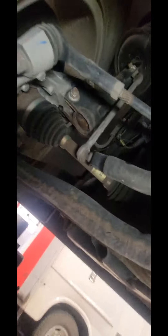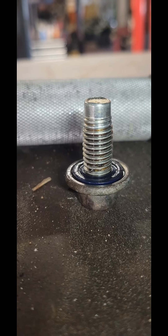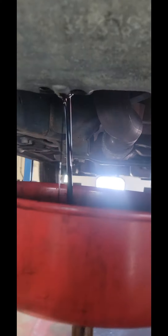We'll jack it up, check the suspension, check the tie rods — no greasers, this one doesn't get any grease. Look close at the bushings, CV boots, everything else, end links again. We'll get a quick rattle with suspension loaded because wheels are on the ground. Drain plug out, oil draining — checking air pressure.